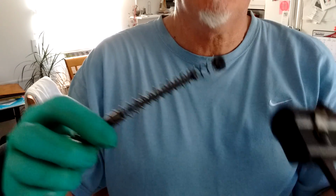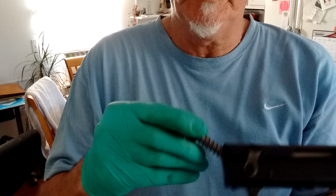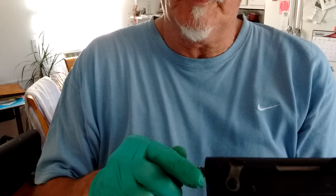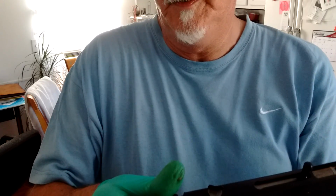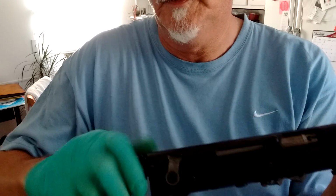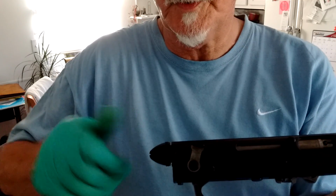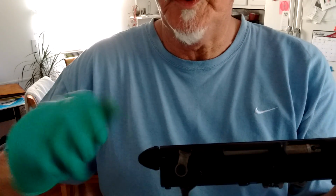Put the spring assembly back. Now it's kind of hard to get this back in, so you got to be real careful and gentle while you're doing this. Make sure you don't bend the spring or whatever. Be real careful and do not cross thread this. Make sure it's going real easy when you're turning the threads. There it is. Sweet. Just go real gentle when you first start. If you feel any resistance, loosen it back up and start it again. Alright, if it's going smooth, you're good.